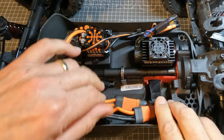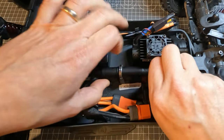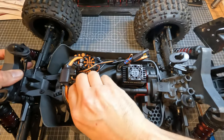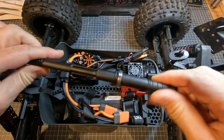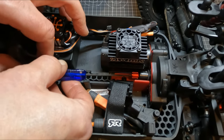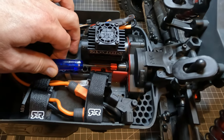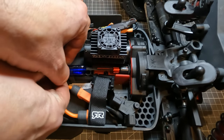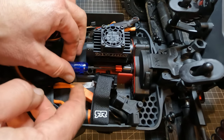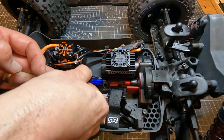You need to get the center drive shaft out — it's spring loaded and pulls back. You need a suitably sized two mil hex driver; this one from a Tamiya set is really quite good for this. You don't need to remove that red bit because there's a hole through the middle of it. Make sure you don't catch on the screw of the clutch, and then if you hold the wheels in place you can tighten or loosen it. That's really useful — you don't have to take all this apart, so if you've heard the clutch slipping you might want to do it up half a turn and just test it again.